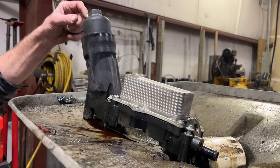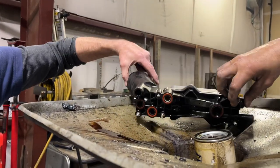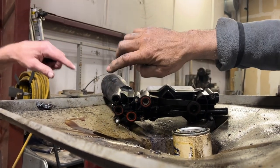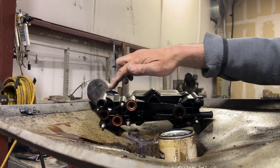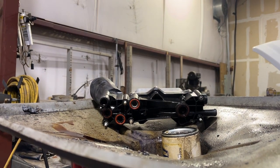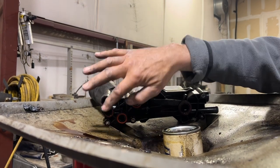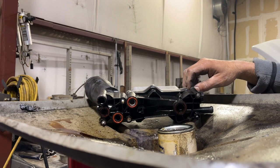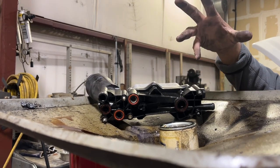The mechanic explained: when you're torquing on this, the whole thing tries to break. These are coolant, this is oil — these right here end up leaking because those are just O-rings. This port goes in, but these just sit on the top, and within time it just breaks loose. These aluminum base parts are light metal, so what happens also is with the heat and removing it, they expand and stretch.